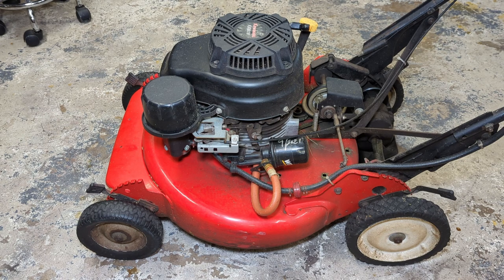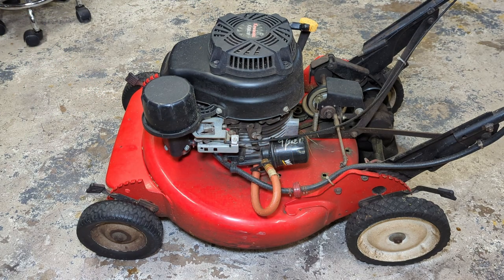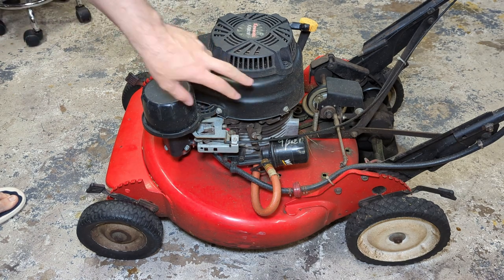And I noticed pretty recently, I've got a bit of an oil leak. So if you look right in here, it's black. And I've washed it off and it's come back, so I know that something's leaking. I think these engines are known for having a sump gasket leak. And these have kind of an unusual design. Normally the bottom of the engine bolts in from the bottom, but this is what they call a bucket engine. The sump cover is actually on the top.